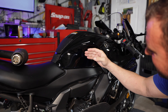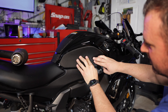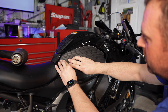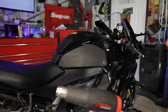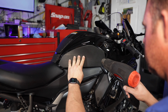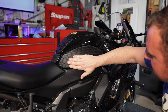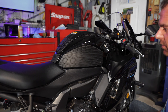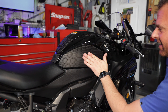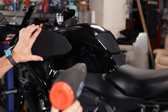If you have a hair dryer I suggest using that rather than a heat gun. We want everything nice and pliable and the surface at least 80 degrees as specified. Start from the center and work your way out. The hard part is that the fairing curves up, around, over, and down — so the grip really needs to be pliable to conform and stay. Keep applying heat as needed. It came out really well and feels like it's hitting on all spots — worth the sacrifice of burning my finger.